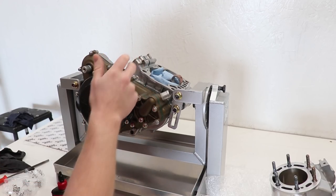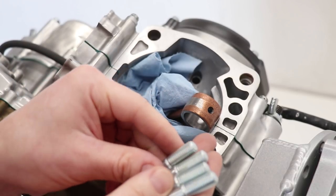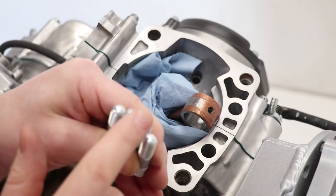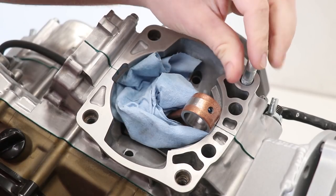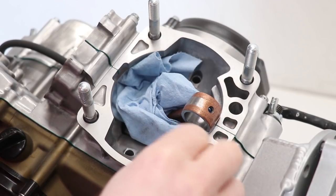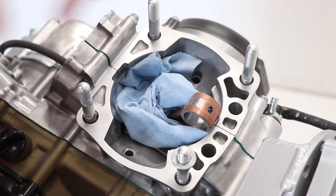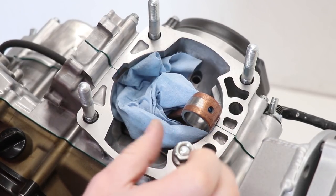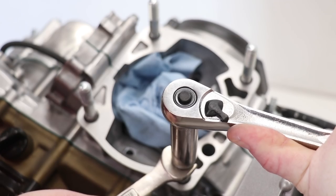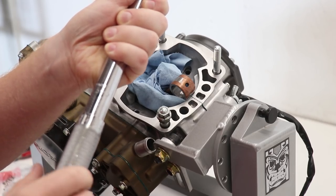The piston is all ready to go, but one thing I forgot is the cylinder studs, so I'm gonna thread these in right now. Since these studs are prone to seizing over time, I'm putting some anti-seize on the threads. There are two sides to these studs — a rounded face and a flat face — and the rounded side faces up. To tighten down the studs I'm using two nuts locked against each other: thread the first nut on upside down, leaving threads exposed for the top nut, then tighten the two nuts against each other to thread the stud into the case. These studs only need to be torqued to 12 foot-pounds.